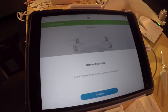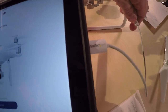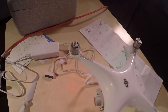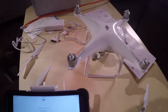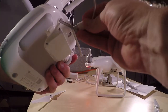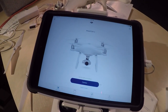'Upgrade complete — connect remote control to use aircraft.' I hit Complete and unplugged the Lightning cable from the aircraft, then unplugged the USB adapter. One quick note: I pulled the propellers off while it was updating, because there are stories about props spinning up during updates and the drone flying off the table — they didn't spin, but it's probably good policy. I'm going to plug the cable back into the remote and proceed.